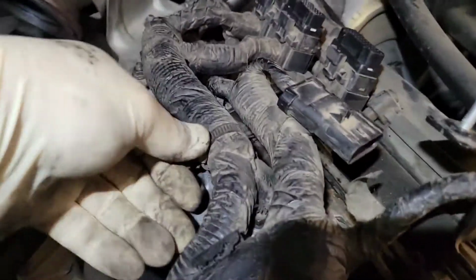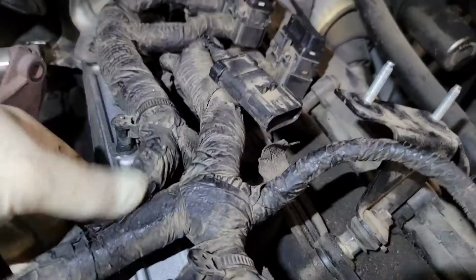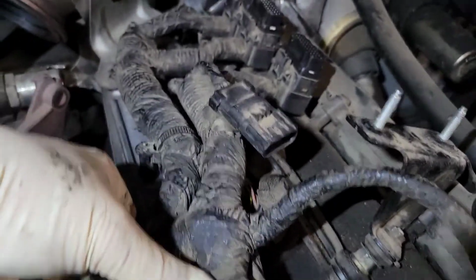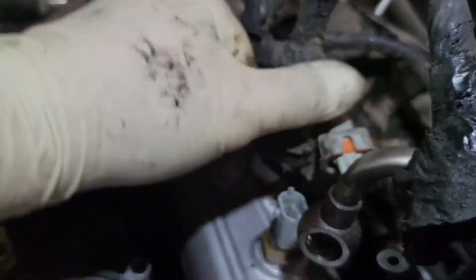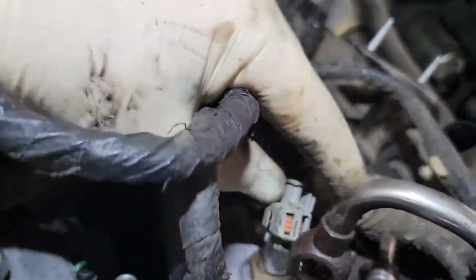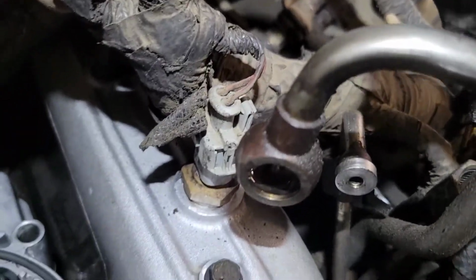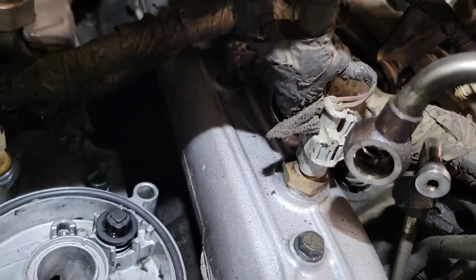Okay, I'm gonna go ahead and clip my harnesses on. That way it holds them in place. This one's missing most of them. One more tip, and I've done this many times before. Go ahead and plug this manifold absolute temp sensor in now, so you don't forget.